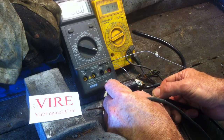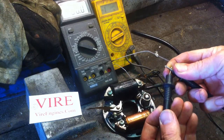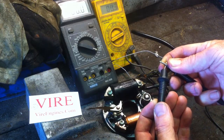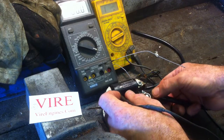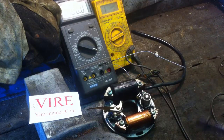This settles down to 2 ohms, and if you subtract the resistance of the leads — which in this case is 0.3 — that's 1.7 ohms on the LT. So those are fine. There's nothing wrong with that coil and we'll show it sparking in a minute.